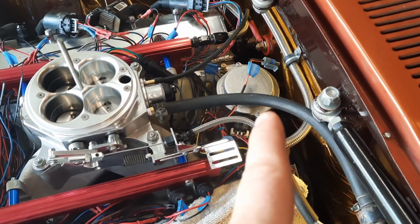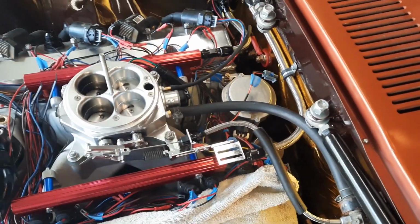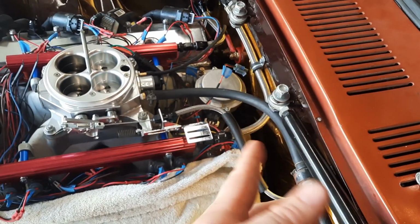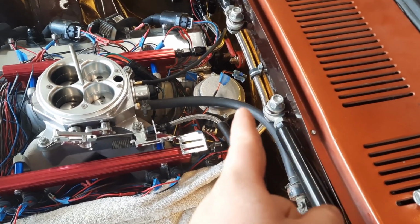Now I'm gonna put myself on blast on this one, and I had 2 more issues after my last explanation of things that I had wrong with the fuel injection setup, and the main thing pertains to that guy right there, the cam sensor. Because this is a Vortec distributor style cam sensor, I don't know a lot about these distributors. I know enough to make an engine run and make it run decent, but you can't use the same logic with the Vortec distributor, especially when you buy one from EFI Connection, or maybe DIY Auto Tune now has it, because they have that silver cap on top.